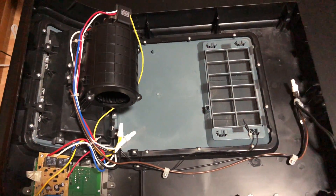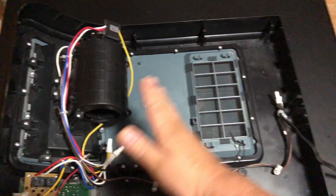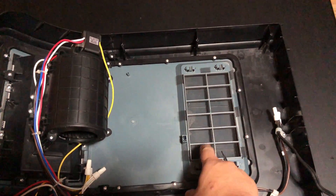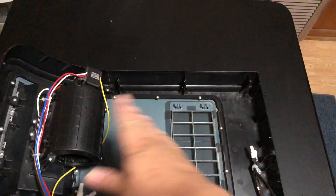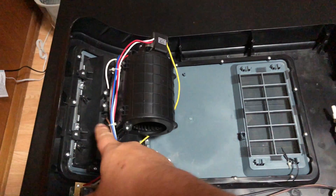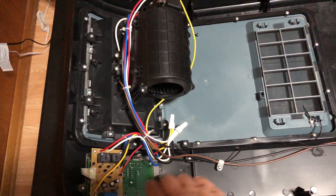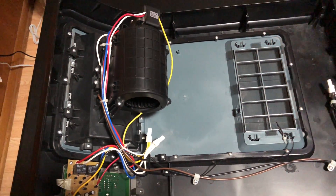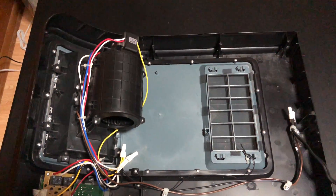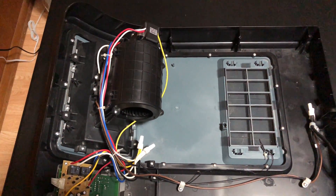You can see this is the inside of the heater. As big as it looks, this here is actually all the heat and electronics — everything else is empty pretty much. Here's your filter, which is really not much of a filter, it's just a mesh over it. No ducting, nothing — it's just empty plastic inside. Here is where the ceramic element sits, this is your blower, and then this is the relay and your electronics to control the heater.